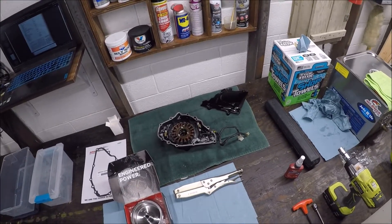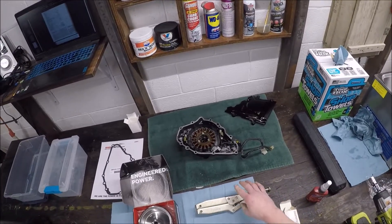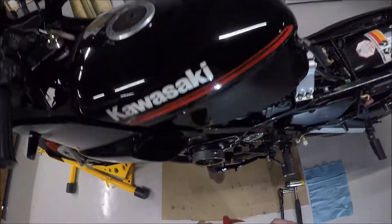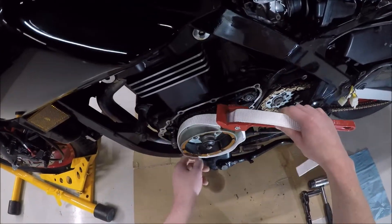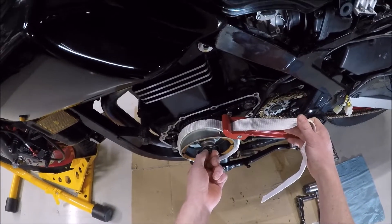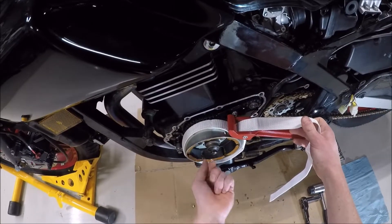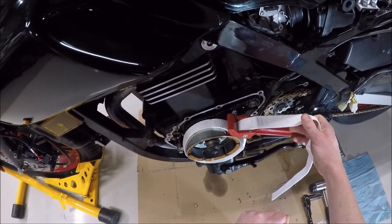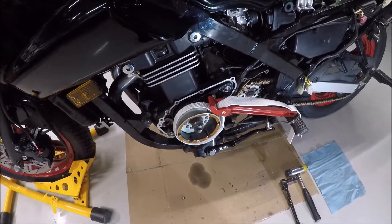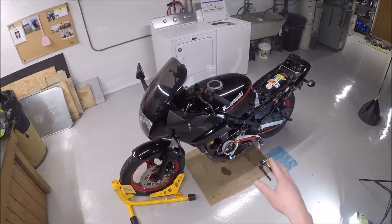The big reason you need a strap wrench: I also bought a flywheel and clutch holder, which won't work here. I need to come over, hold the flywheel steady, and then use the left-handed thread bolt — a 14 millimeter. Normally you'd pull it off going left, but you're going to go right. Don't go backwards or you run a lot of risk of damaging it.